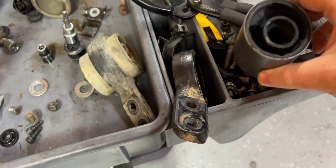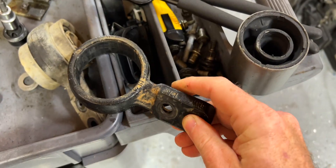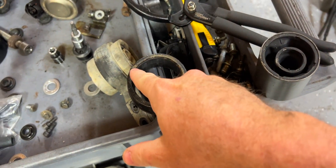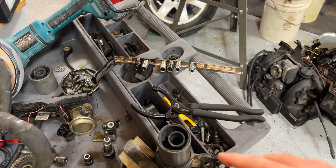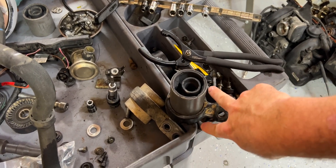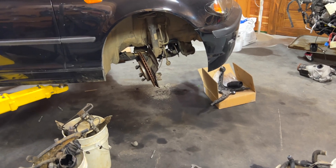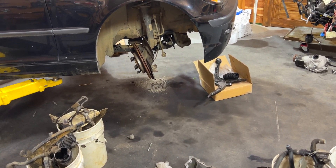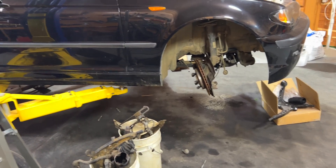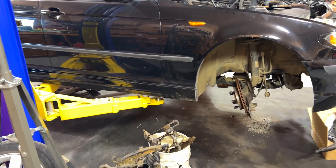Now when you press these in, there is a mark right here, as you can see. Whenever you press it in, there is also a mark right here on top — that mark lines up with this mark when you press it in, because the bushings are actually offset on the all-wheel drive cars. This is totally different than a two-wheel drive E46; they have the bolts for this side-by-side instead of vertical. Here is the old bushing and they're just ratty. The whole angle of this car is to make it mechanically not totaled — it was mechanically totaled, not worth fixing. But E46 prices are coming up, this is an all-wheel drive E46, the leather was perfect in it, it needs minor paint repair work, and it's going to be a really nice looking car.